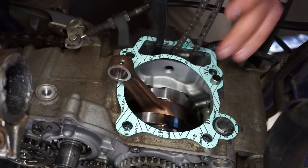So we're going to do 1.66 millimeters, the shim size we have now, plus this size that we want to add to the shim. It's going to give us the new shim size of 1.856 millimeters. And we found a 1.9 millimeter right here, so we're gonna add that in, and hopefully that fixes our problem. All right, I think we pretty much got these valves good. We're gonna test that once we get the cam chain tensioner in. I wanna make sure that timing's perfect with the adjuster in.